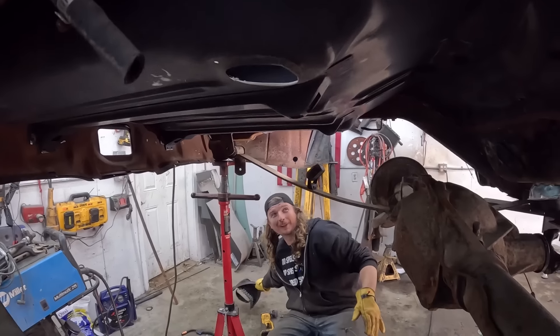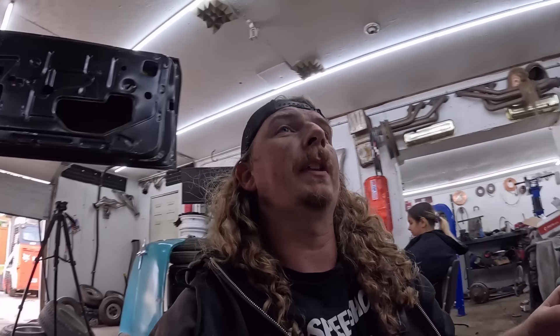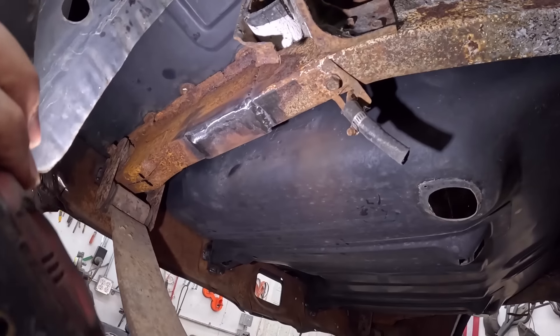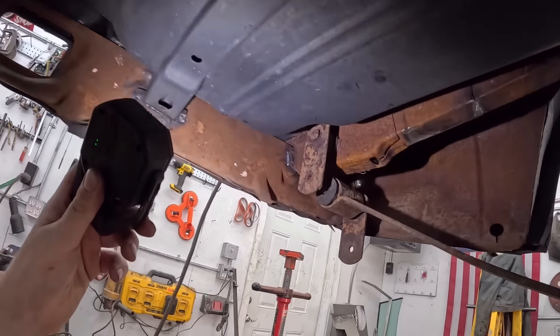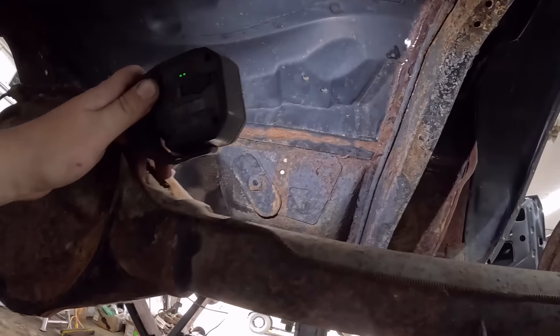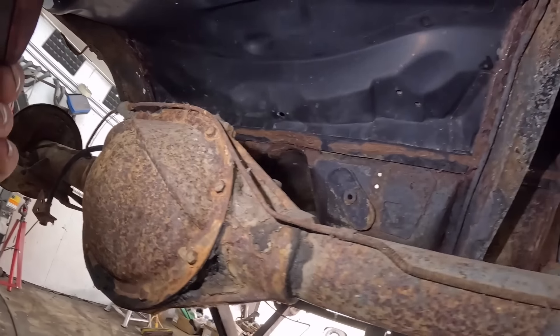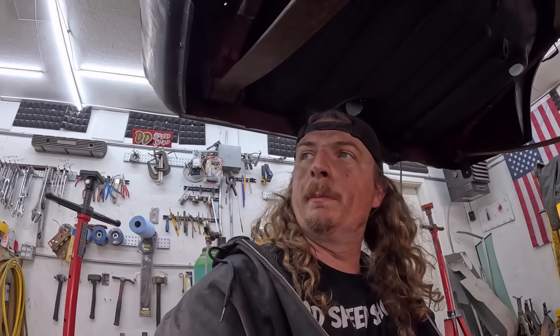Side wipe into a good finished product. Look at this one again. That was nice and full. It came out pretty good. I'm happy with it — welded it, ground it down. Yes, could have V'd it out and X-rayed it, but come on guys. I've seen way sketchier stuff. We've got that all welded in. I ended up kind of seam welding the frame just because why not. We got this all dialed in. We cleaned up some of the welds up here, just kind of doing our thing. Basically I think it's ready for a little seam sealing and undercoating. There's a couple of funny spots but we're not really trying to hide it. This car, if you're going to make a nice car of it, I would recommend rear frame rails.